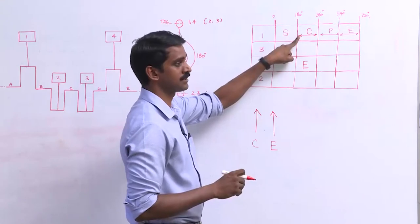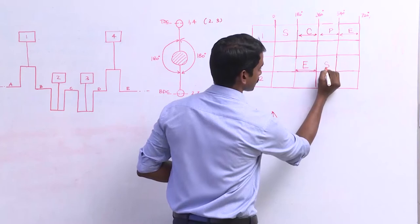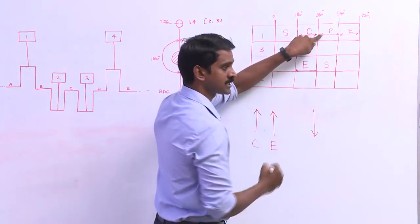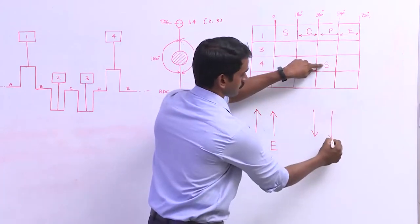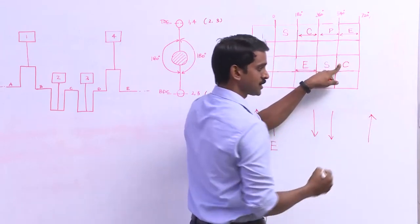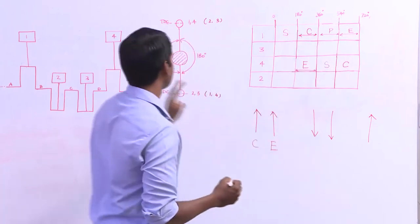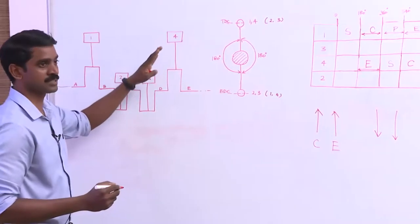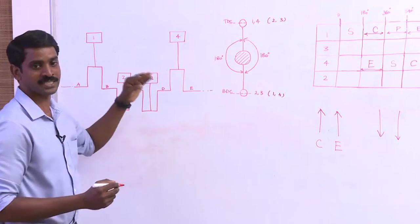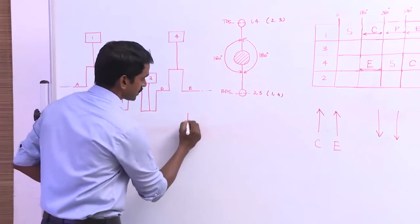So piston 4 is in exhaust stroke while piston 1 is in compression stroke. When piston 4 completes its exhaust stroke, then comes the suction stroke. When piston 1 is descending from TDC to BDC in the power stroke, piston 4 is also descending for its suction stroke. Then piston 4 ascends for compression while piston 1 ascends for exhaust. At any given time, piston 1 and piston 4 move together but are in different actions, determined by the camshaft. The camshaft opens and closes the intake and exhaust valves, determining the event inside the cylinder. This leads us to a term called firing order.